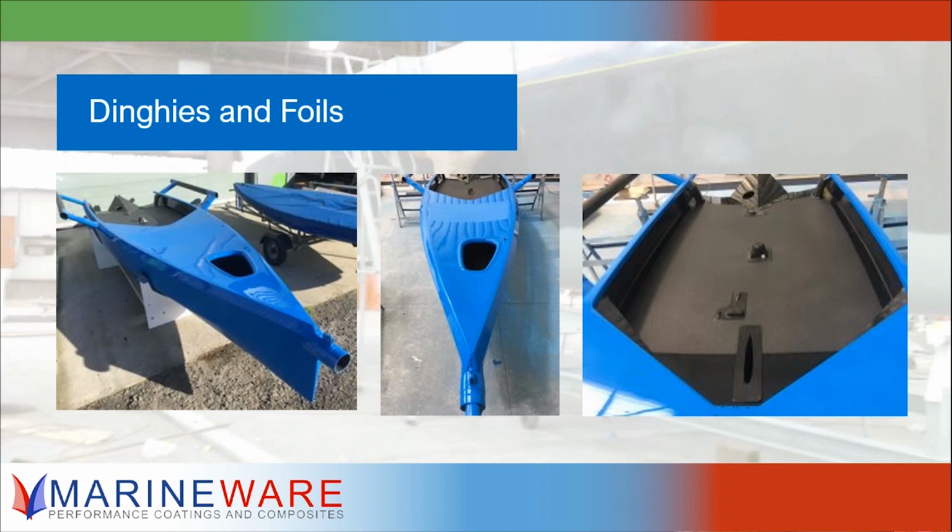Okay, so it is a base color and then the clear coat over the top. Yes, yeah. So the clear coat was just all Craft 2000, just on the deck down to the gun ledges. So you're still getting the advantage of using the Durepox primer for what it's for, but then just some UV stability on the deck.